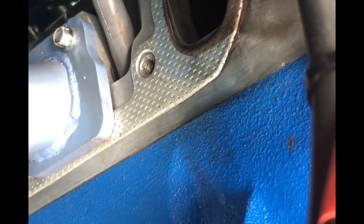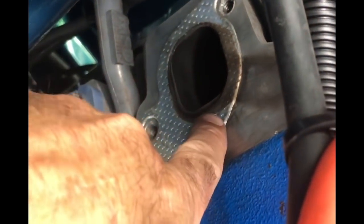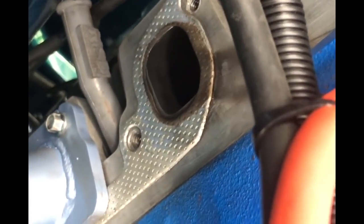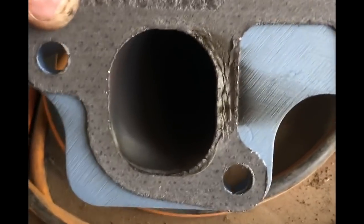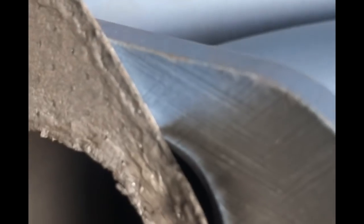So I checked the gasket to the head and it fits perfectly. Port matched to the head nicely. But look, the header being a 3V and a 4V header, the port of the header came outside the gasket. So number 1 and number 8 leaking. That's lined up with the bolt holes and the ports and all that. And those ones are all but, like if you get it and poke it, that's actually in the port. It's a fraction.